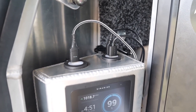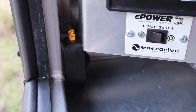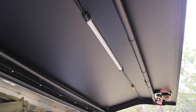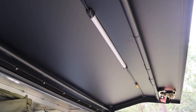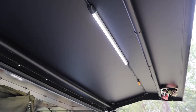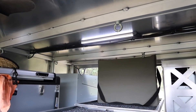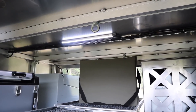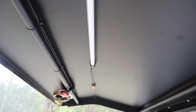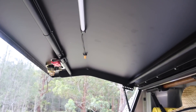We're running four USB ports up there on top of the panel. Down below the panel we also have our core lighting kit — basically a dimmable switch just there in the corner. The wire runs up on the canopy door. We've got the core lighting kit throughout the canopy; it was the easiest way to install it. We have a kitchen light — just white light — and we can also change it to orange if we want. We can dim the white light right down and also dim the orange light right down. Around on the driver's side you can see the core lighting in the centre of the canopy and most of the power cables running to the back. And I can also plug in more lighting if I want to with that orange plug down the end — I can connect more lights if need be.